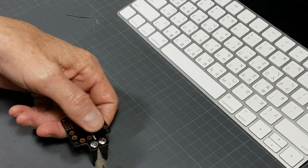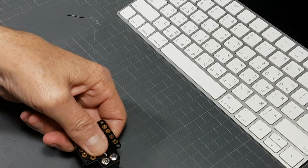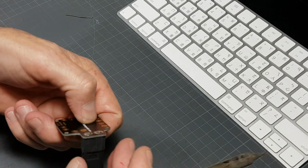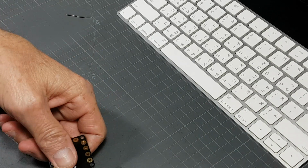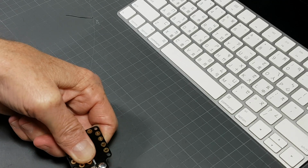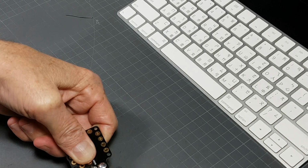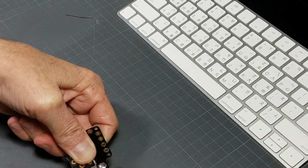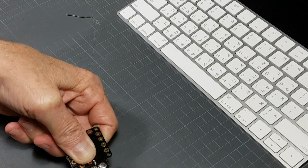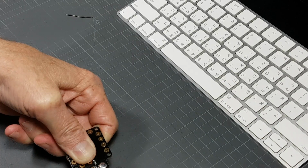Alright, so I'm going to, of course, get ready to apply pressure on this now, because as soon as I heat this up, the rubber will release and push the PDB up, so I'm going to push on that already, heat that up. There you go, it's flexing nicely. Let it cool down, don't move while it cools down, wear gloves. Don't like your thumbs feeling very hot.